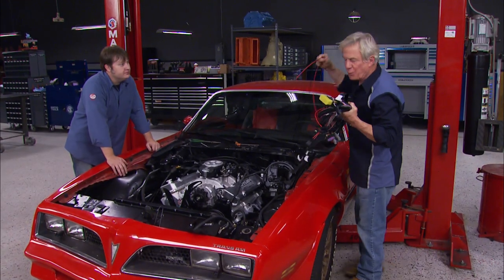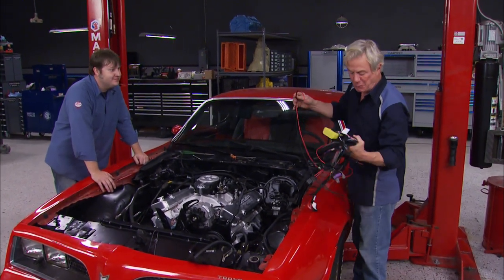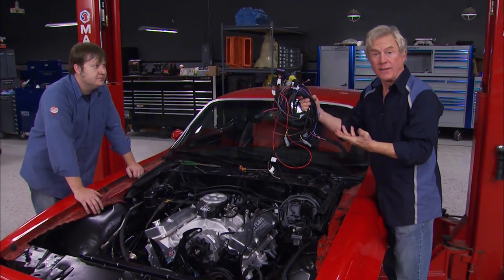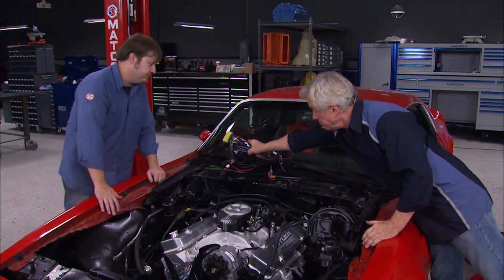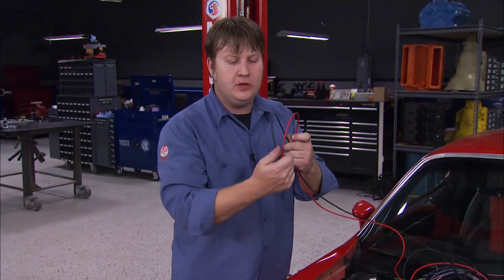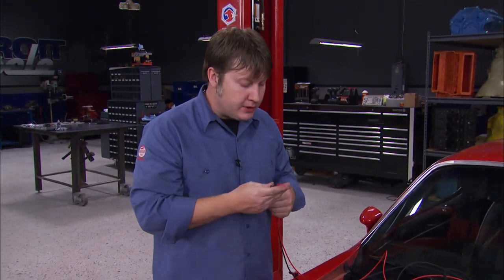You know, most guys I know would rather get a couple of root canals than deal with wiring, and I can't say I blame them too much, but the folks at Fast took that into consideration when they designed this harness with the fewest connections on the market. Whenever wiring up this harness, there are a couple things that you need to keep in mind. They have two heavy gauge wires that are labeled battery positive and battery negative. You want to make sure to run both of these directly to the battery, not splice into the original harness of the car. Because whenever you do that, you're running the chance of getting into some interference or electrical noise. And fighting that issue, man, it can be tough.